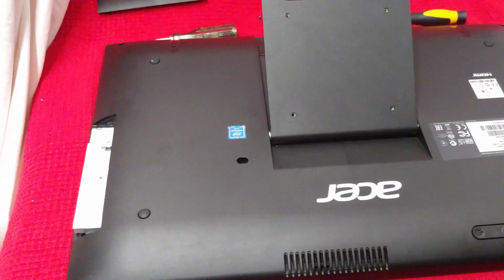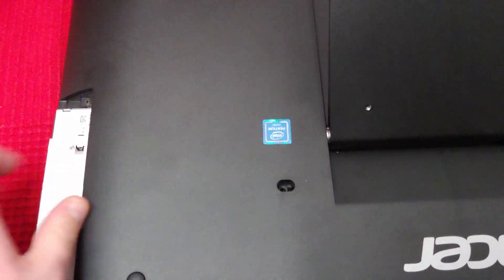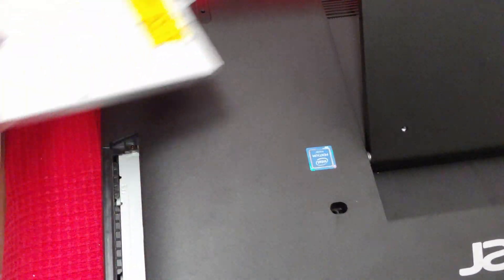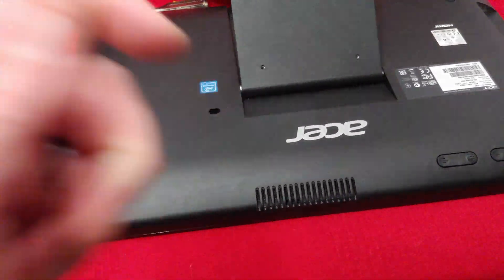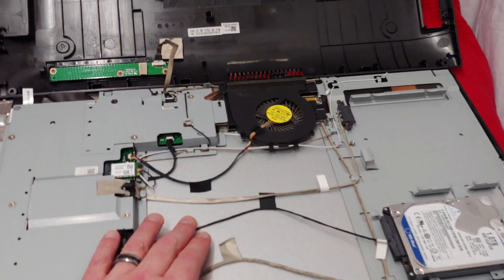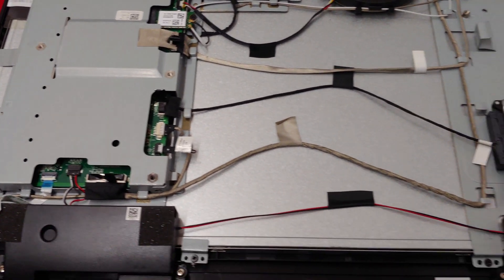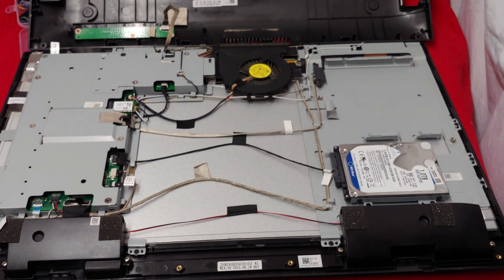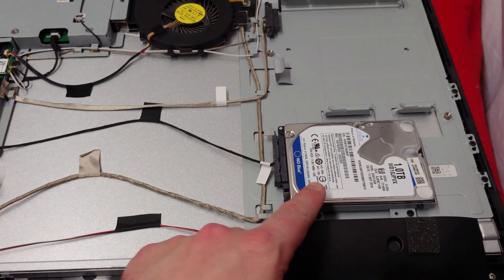Next up, we're going to do a teardown. All I'm going to do is take out all the Phillips-head screws around the sides. Make sure you start with this one and be real careful — this is the DVD drive. Unscrew it there and be very careful while trying to take it out. Unfortunately since this unit has aged, it's a little bit of a snap, but I can get that back on. After that, you'll want to get a spudger or a guitar pick to pick these open — there are clasps, little plastic hooks in there. I recommend you unclip from the back and open from the bottom. We've got some heat piping going on over there. All the major components are under that shielding. All I really need to get at is the hard drive right here — that's where the CD drive came from. You can't change out the RAM, don't even bother trying. I've got to warn you about this cable right here — be real nice and dainty, you don't want to break that one. I'm going to upgrade this to a solid-state drive.